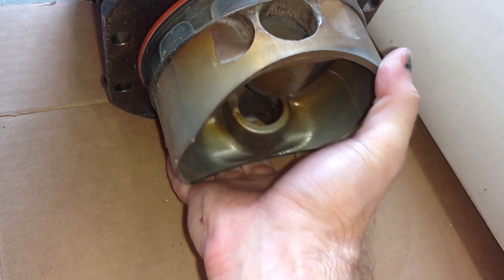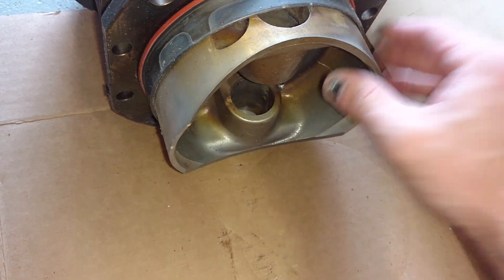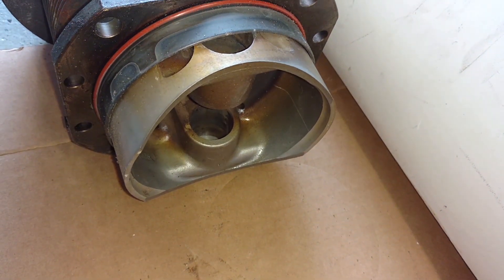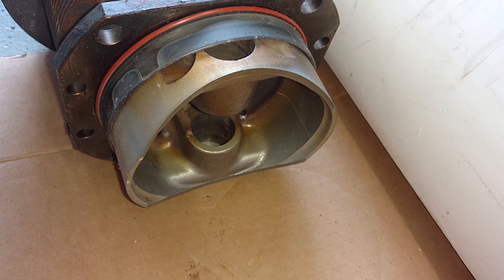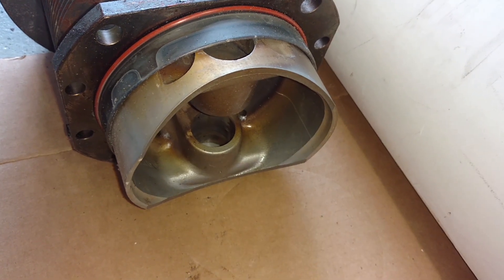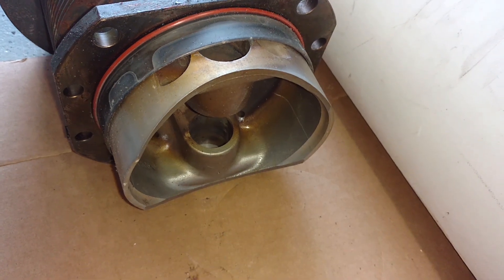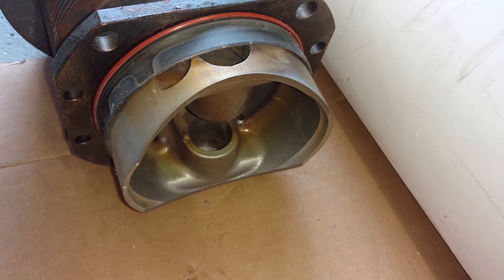You can see it is a loose fit, so some combustion gases do escape past the piston down through here into the crankcase — that is called blow-by. That blow-by is what gives you all that crankcase pressure and flow through the breather tube overboard.